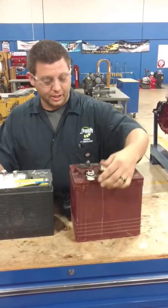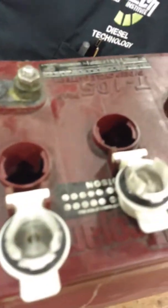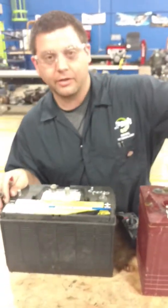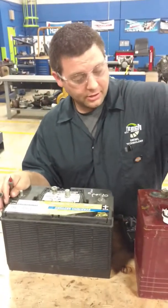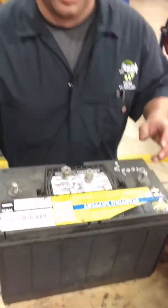The difference here is you can fill these up with water. You want to make sure that your cells have enough water. You can use a flashlight to see in there. Fill it up — that's why your battery is not charging. Put these batteries here; you don't want to pop off the top behind this little piece of plastic tape.